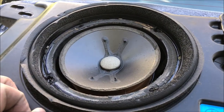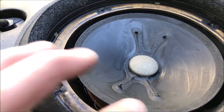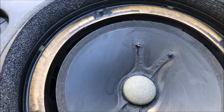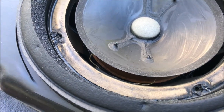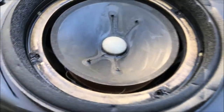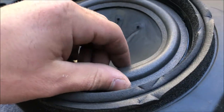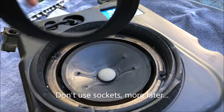I've completed the cleaning — the outside is all cleaned up, a little tacky but all the original adhesive is gone. I've cleaned up the speaker cone as well. One thing to note: make sure the screw holes stay lined up between the outside of the speaker and the surround, because if the cone spins while you're removing the old adhesive and then you glue it down, it could be in the wrong location. I also checked the fitment of the new foam ring — per the instructions you can gently stretch it lengthwise and in the center to get it to fit.